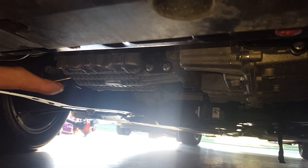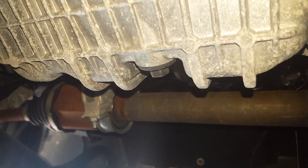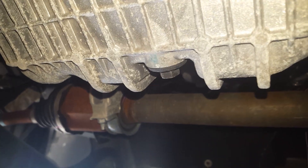The oil pan is on the right side of the car and there's the bolt right there — that's a 13 millimeter. You'll need an oil catch pan. Go ahead and loosen up that bolt and let all the oil drain out.